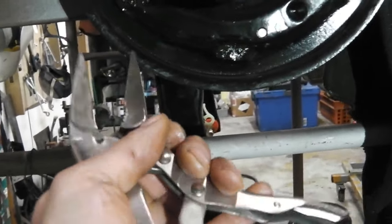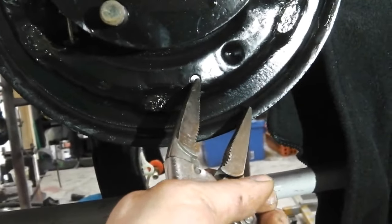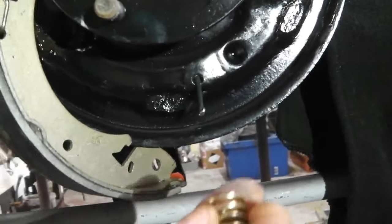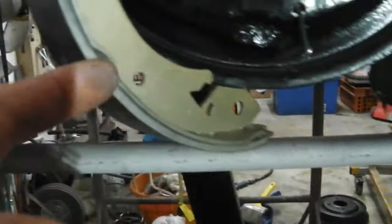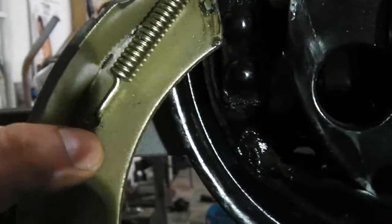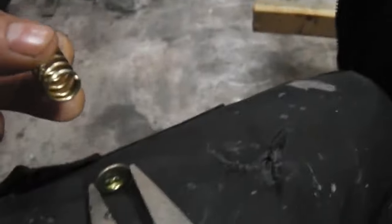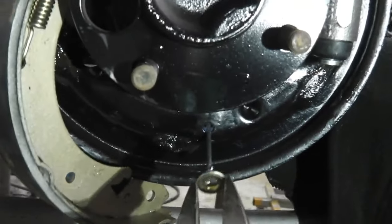Let's now get the shoe and we're going to hook it on to this, and then we're going to lever it into place, and I'm going to get that pin in there. Alright, so let's do that. Right, so I'm standing by with a pin through there, my spring, and inside the pliers, locked on, is our locking washer. So we're going to get the shoe, which I've now hung on the end of that spring, and then you can use the shoe to pull down and lock into the pivot point there. So we pull down on the shoe, and then offer it across here and let it slot onto that pin. It'll hold itself on that pin till you're ready with this spring. Then we push on with the pliers like this and turn and lock.